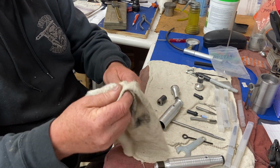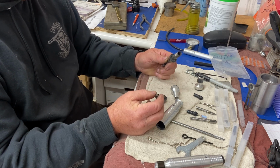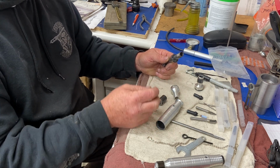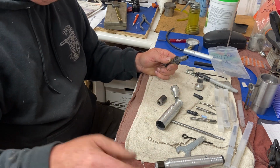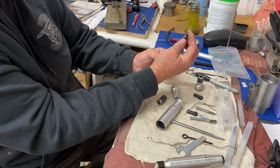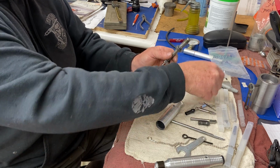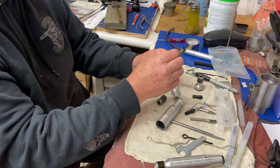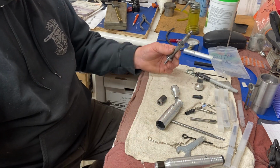That's the 1/4 inch one. And that's what I pretty much always use. I have one grinder set up with the little 1/8 one. Then I have my other grinder set up for doing the polishing with the flapper wheel. Okay, so here, this is how you change your collet. So there's a 1/4 inch one, your 1/8 one, and then you can put your 1/16 one in. I'm going to put the 1/4 inch back in. So that's the bit that I want to use is going to be in there.